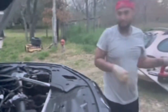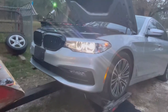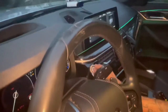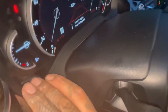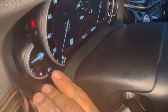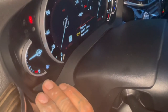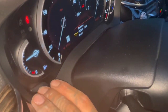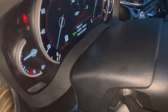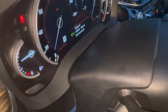We've got to reset the oil light. Turn it on — you're going to hit the BC button three times to get into diagnostic mode. Click through until you find 'Engine Oil Reset,' then hold it down. It's going to say 'Reset Yes' — hold it down again. Boom, resetting in progress. It now says 9,000 miles to the next oil change, but we're going to change it in about 6,500.